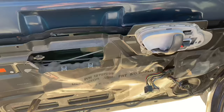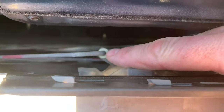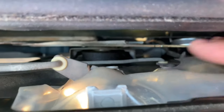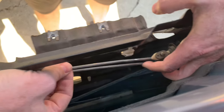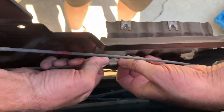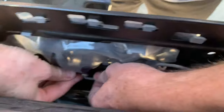We don't need to take the whole panel out — we're just trying to get back here. You can see where this rod connects to the door opener, and down below is where it connects to the lock. These rods sit in little guide clips, so I pop it loose from the guide clip to give me a little room to move it around. Then there's the guide clip for the lock, which I'm just going to pop out to give me a little room. It just pops loose from the old one, and this one pops out too.